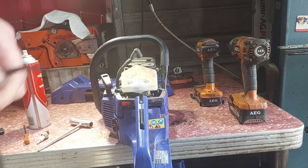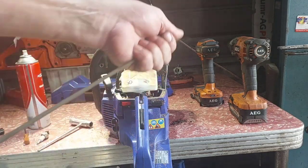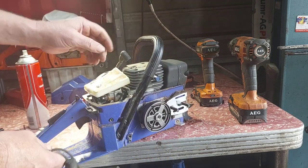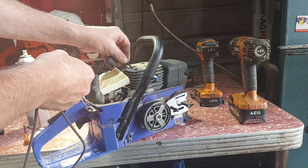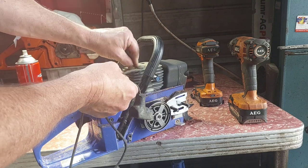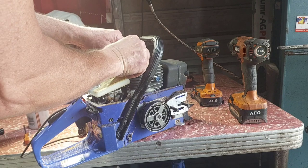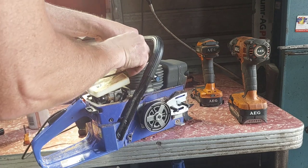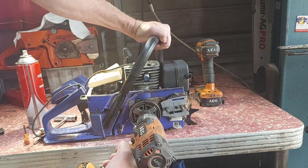I've got my special painted solo pull-starter cord - god knows how many years old this thing is, from the 60s or early 70s. I've already turned the motor over so the piston is coming up, because you don't want to push the rope through the exhaust and cut it. Be careful - the piston is almost all the way to the top. The rope is quite heavy gauge - I want the whole thing stopped. Now it should undo.